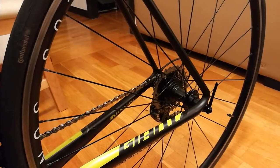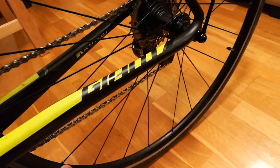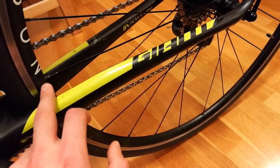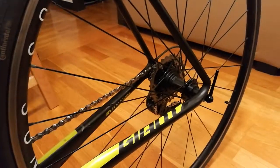So with really expensive aluminium wheels, that's what you're paying for. You're paying for the machining tolerances. And it's not just the apparent location, because you see here, don't forget these are double walled, so it's where the spoke nipple actually ends up resting in there when it's tightened up. So yeah, that's just one minor thing.